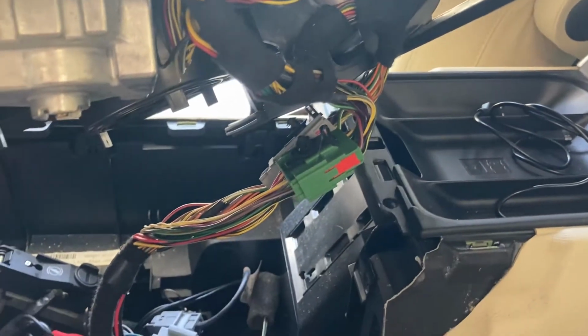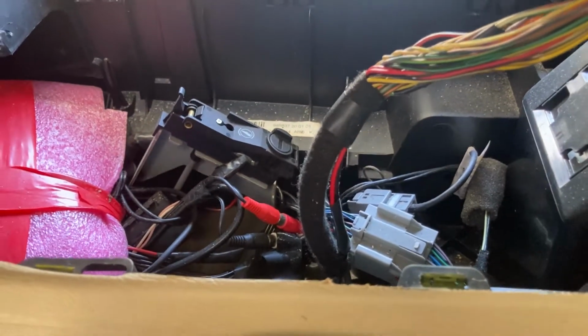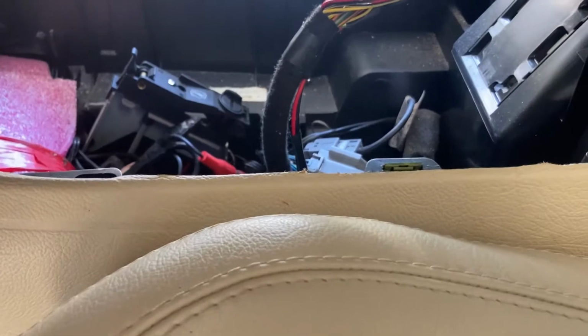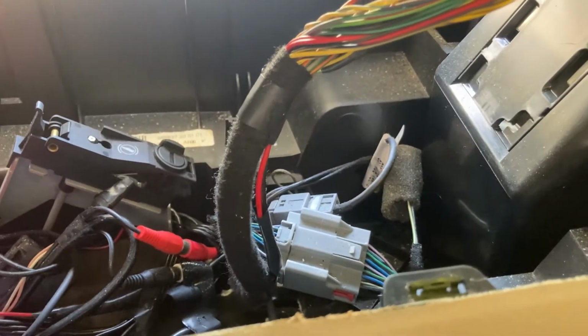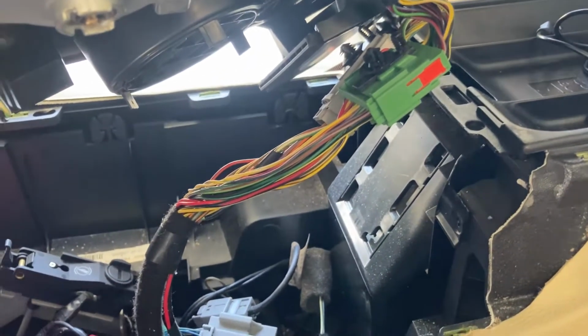And here's how it looks like underneath. It's, well, a mess, really, with all manner of controls and everything, but don't get scared. Basically what we need to do now is just to handle these two controls, because these route all the wires from the car to the units inside the center console, and after that we're actually able to take the center console unit out of the car.